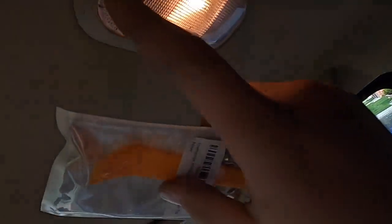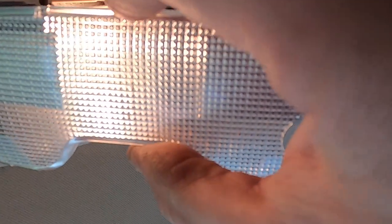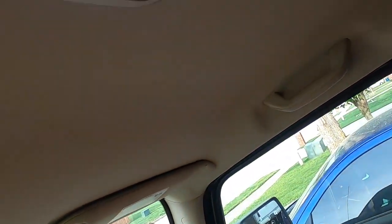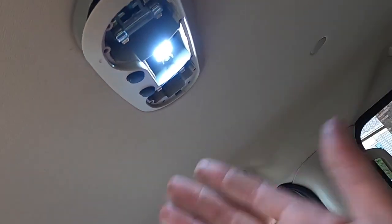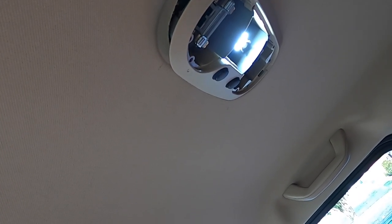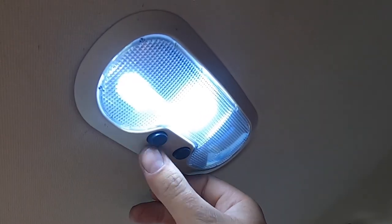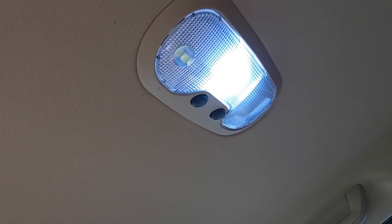Should be able to just use this little tool, stick it up under here and pop this off — yep, that's exactly how you do it. There's a little tab on this side, you pop this off, and this lens holds the entire dome light assembly up there. Grab some needle nose, reach up there and pull that guy out — pretty straightforward. I'll link this kit down below. These just go right up there in place and look so much better than the old halogen bulbs. This is something I like to do to any vehicle that doesn't come with LEDs in the interior. It updates them and brings the 2010 interior to the modern day. Don't forget LEDs are polarity sensitive — if they don't work the first time, just flip it around and it should turn on.